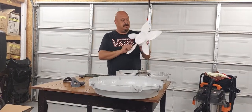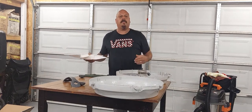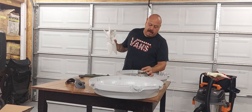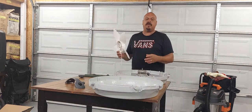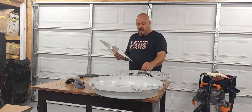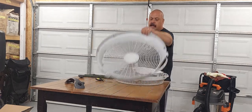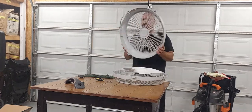Okay, so now we're going to put the fan together. As you can see, the fan blades are clean — back and front. I scrubbed them, rinsed them, did everything I was supposed to do. Now, in order to put the fan blades back, don't forget you do have a flat side. On this Wind Machine, the flat side is where the little hole is on the actual blades. So if I face that upward, it'll fall right into place. Let's go ahead and piece everything back together.